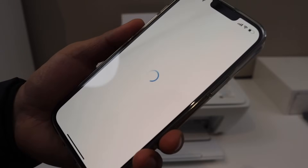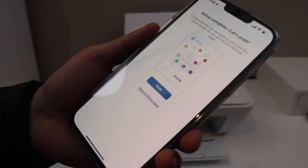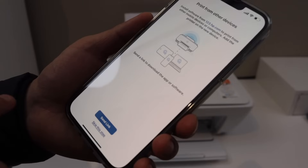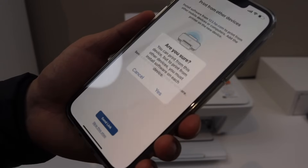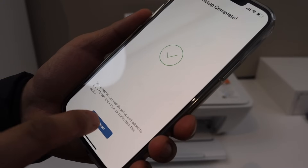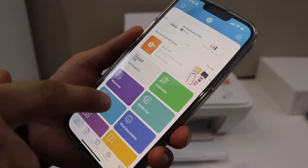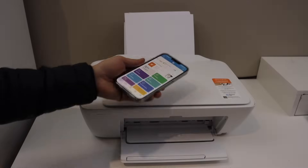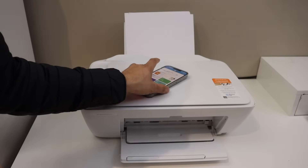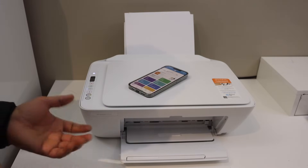Select auto updates for your printer. Setup is complete — you can print this page or skip it. You can also send the link to other devices or skip that. Click All Done and your printer should be available on the screen. You can start using it for wireless printing and scanning. This is how we do the wireless setup of an HP printer — thanks for watching.